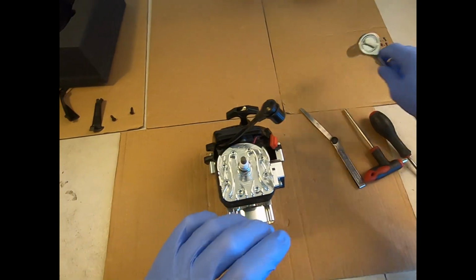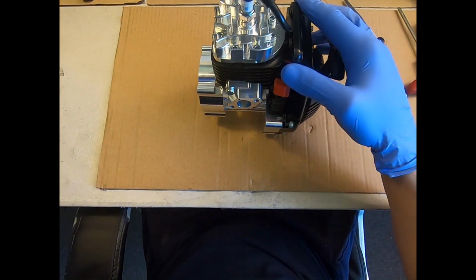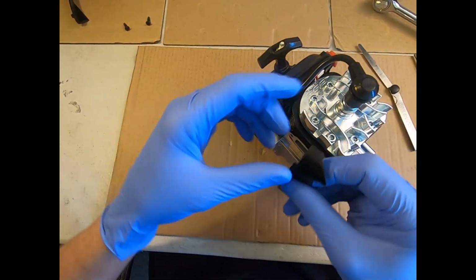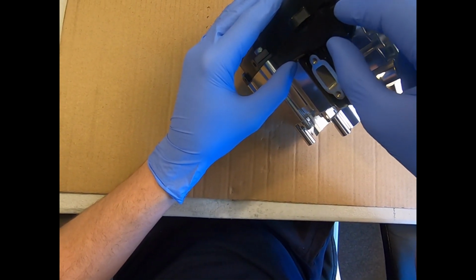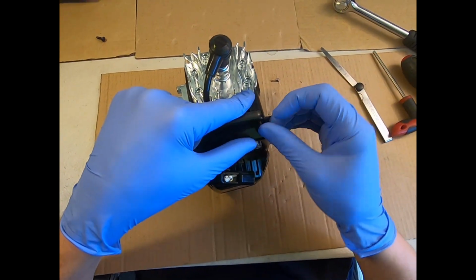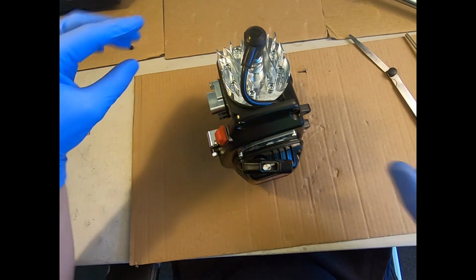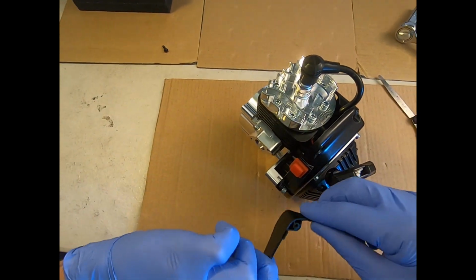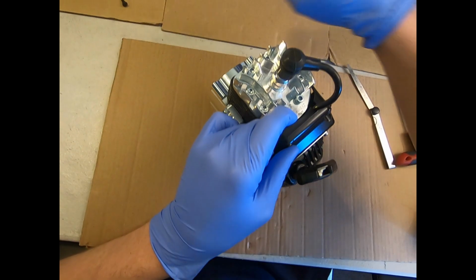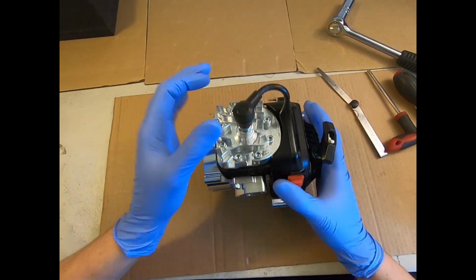So now let's put the plug back in. Tighten that up properly. Put the cap on. And now we're just going to replace the air guides. This little side air guide just locates in the bottom in the case there and into the fan cover, just retained by that Phillips number 2. Twist the coil wire out of your way, and then with the other air guide, again similar fitment, it just slots into the case there and then locates around the fan cover there, and finish off with the Phillips 2.